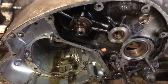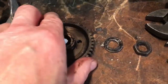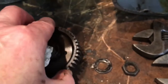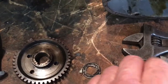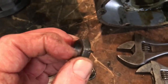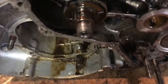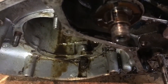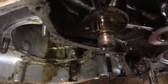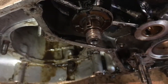About two or three minutes later, finished pulling that off — just being patient — and there we are, we've got it off in one piece. The pinion itself needs cleaning because like everything else it's got ali swarf everywhere, but it's in good nick. The nut though — there's actually no thread left on that nut at all, it's smooth. There is thread on the cam, but you can't see it too well because there's residual thread from the nut in there. I'm going to try and extract that now and also see if it'll clean up with a tap — UNF, I'll need to check.